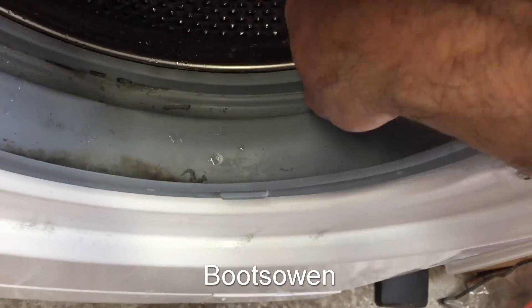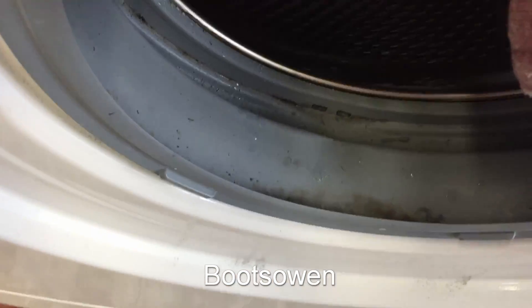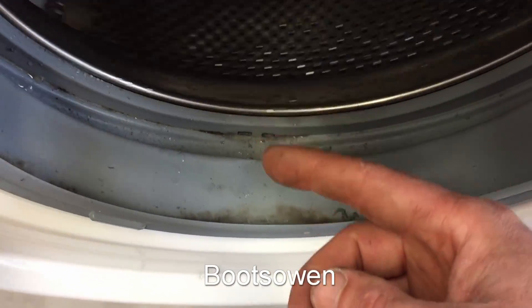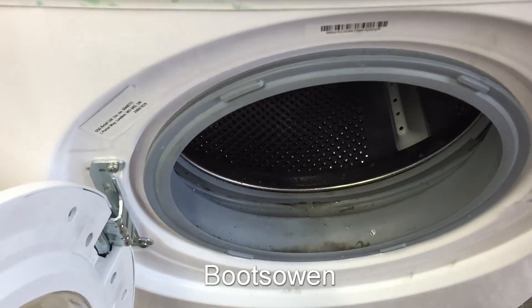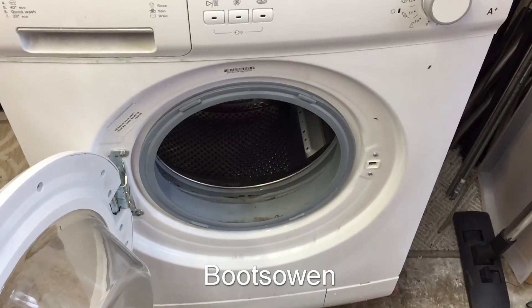You can see all this dust in here — this is all rubber crumb that's come off the door seal — and you can see this tub going in and out here relative to the rubber. It's probable that one of the legs of the spider has come detached or snapped inside, and when it spins around, it vibrates, makes noise, and makes a lot of smoke. So there's not much I can do with this machine as it is.